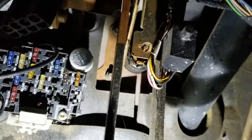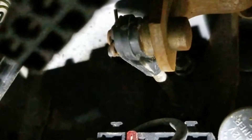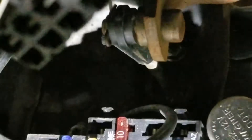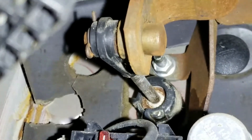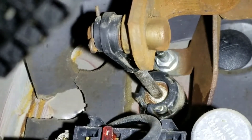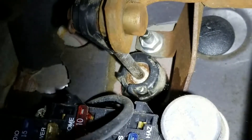To get to that nut, I'm going to take out this washer fluid reservoir. And then on the inside, up under here, you have your clutch pedal. Mine's really not holding any pressure - I can push it easily by hand. But up towards the top right here, this clip is where the master cylinder is held onto the pedal. On the left side you can see the bottom of the cotter pin - just pull that out with some needle nose pliers, and then the whole plastic assembly will slide off to the left. Above the piston you can see the other nut that you have to get from in here.